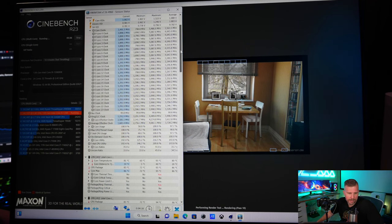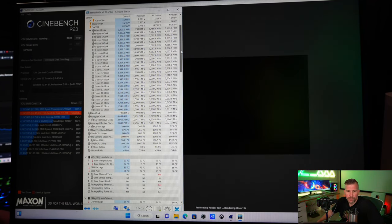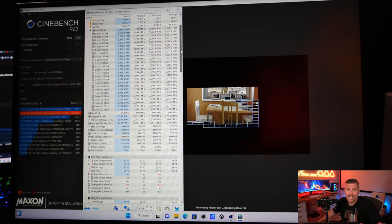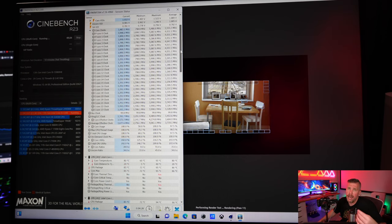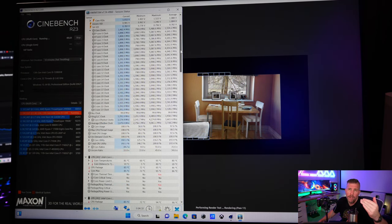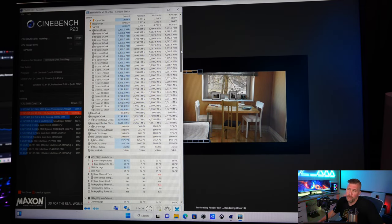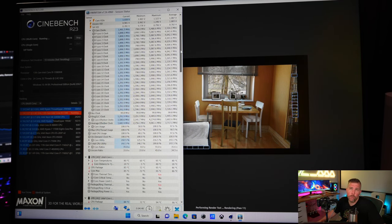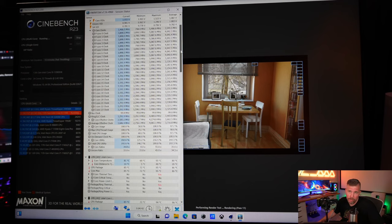That's, I like that. So is it hard to undervolt, and will you make some tutorials or something? So Daydream, I went through how to do an undervolt on the Strix G18 live unboxing video. And it's not that hard. You go to the BIOS, and then you can do a minus 30 millivolt undervolt, which is not that big. The Legion Pro 7i that got 35,000 had a minus 125 millivolt undervolt,